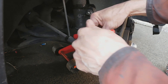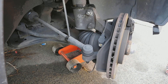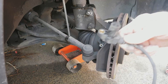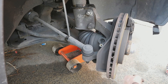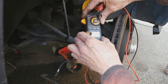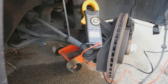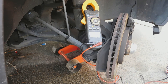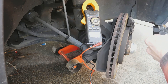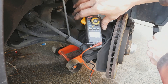We'll take this out — that's the wheel sensor. Let's give it a wiggle. It's got some debris on it. I don't like that. Now we'll test it again — 250 ohms. It gave me 60 ohms last time I tested it. That's interesting, I'm getting an intermittent reading. What pray tell is this muck on the end? I'm going to clean the sensor and see what's going on.